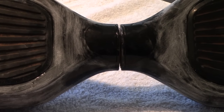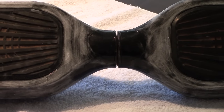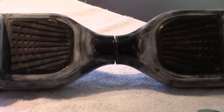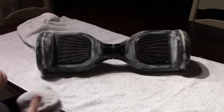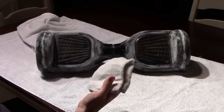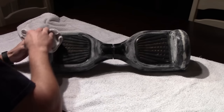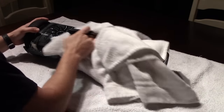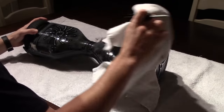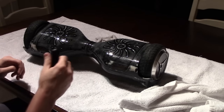As you can see, I've got it pretty well sanded down except for, of course, the paddles and the light indicators. Next step is going to be to take a washcloth or some kind of sponge to get all the extra powder out of there and get some of that dirt off. After we get it cleaned up, we will tape it up. Now we've got the whole thing sanded down. I'm going to use a warm, wet rag with some soap on it just to get all this dust and stuff off. Got it soaked down, cleaned off, and dried off a little bit. I think it will be easier if I remove these bottom panels — easier to paint, easier to tape off.